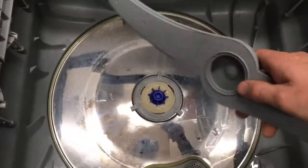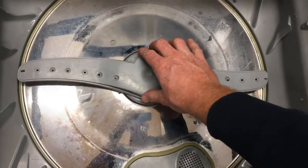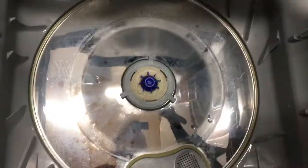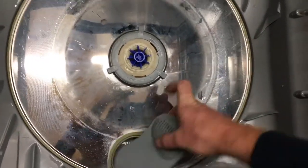The spray arm just lifts off. When you're putting it back together, it's very important that this arm sits back on fully — it doesn't actually lock but sits down in the right spot. You can't just have it sitting on there haphazardly. If it's not on properly, then you can't measure the water level properly.